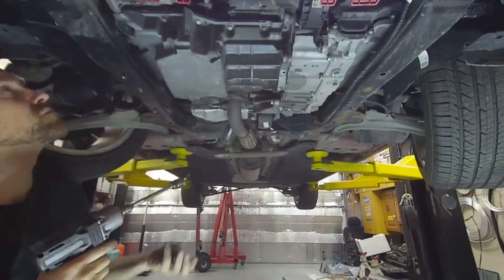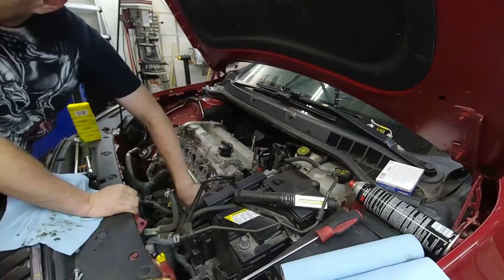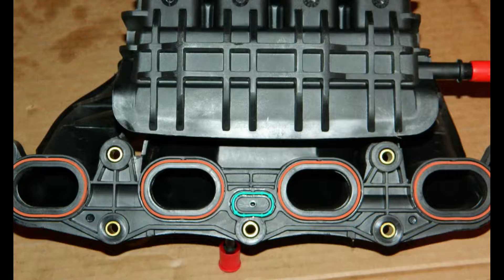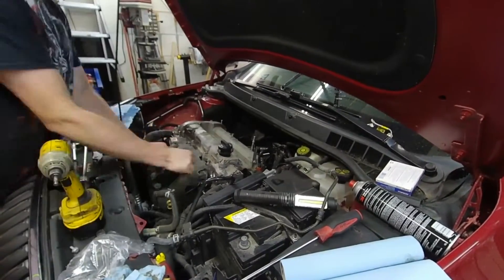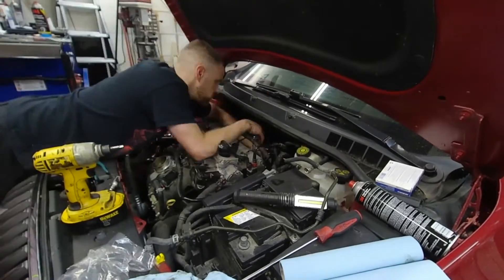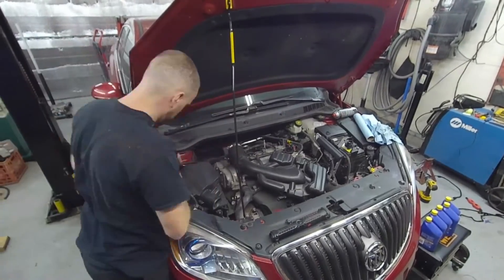I have a quick and important update. On something that needs to be done when you get to this position of the video — I totally forgot to do it and had to take the intake back off of the car after the video. On this picture you can see a hole between the two center ports of the intake. That hole is very, very important to make sure you clean it out — it gets plugged up with dirt and debris from the PCV system. This one on this car was actually plugged up. Take the time to find a drill bit that fits it, and I actually found one just slightly larger to open up the hole a little bit, and it made the PCV system work so, so well.